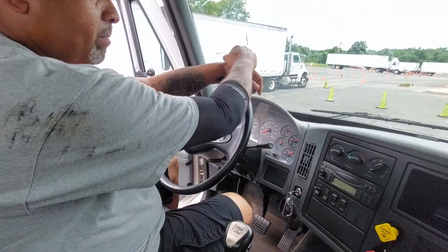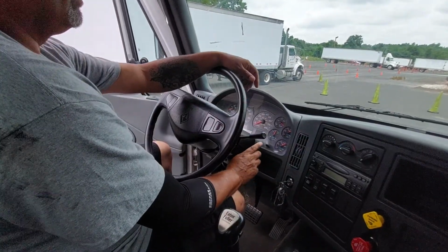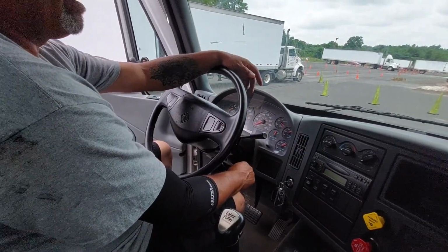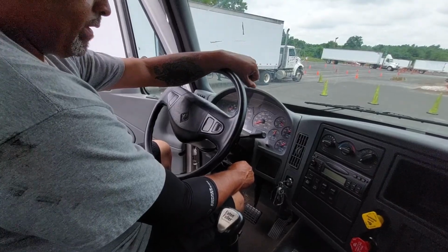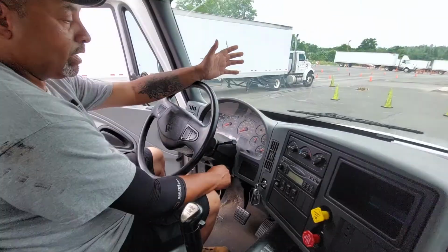Now I'm gonna wait my minute and make sure I don't lose no more than 3 pounds in 1 minute, right? Okay, so I'll wait my full minute. After a minute, if I lost 1 pound, 2 pounds, I will let them know. Sometimes I won't lose anything, so that's a great thing.